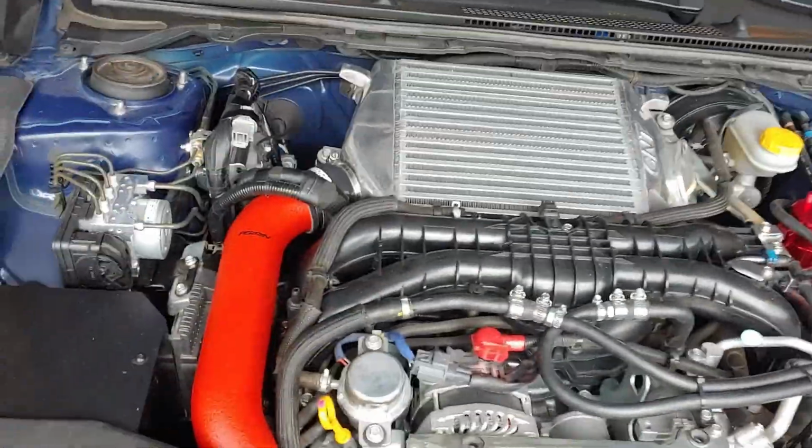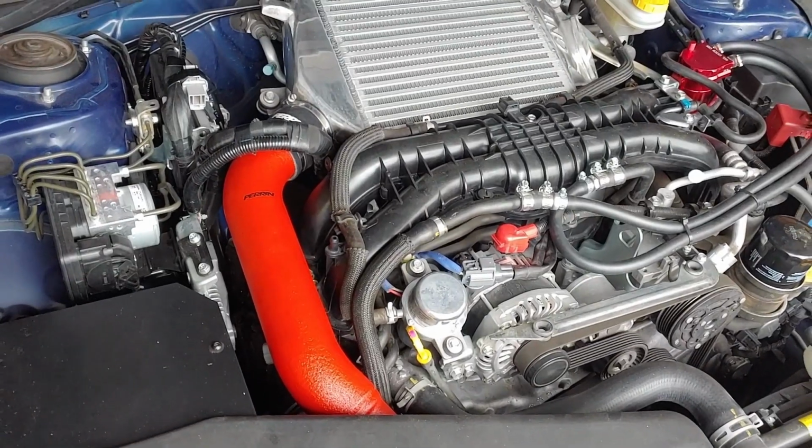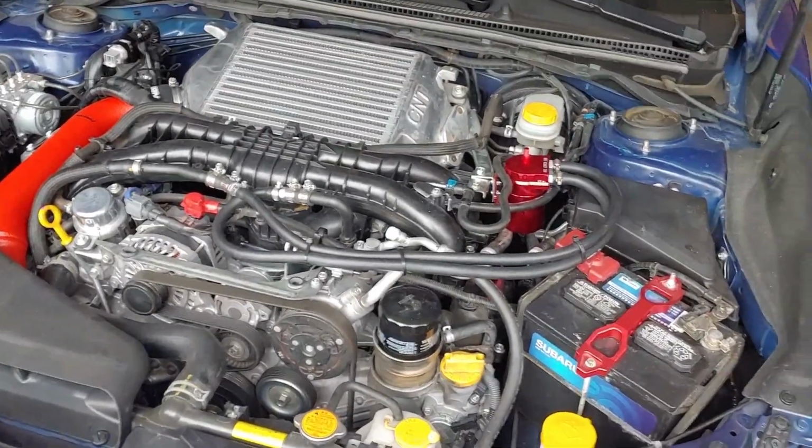Torque specs, upper and lower TGVs. I couldn't find anything totally definitive. Looked on Nasioc and places. People are saying anywhere between 8, 9 foot-pounds all the way up to like 18 or 19 foot-pounds. I settled on 15. It's all put back together.